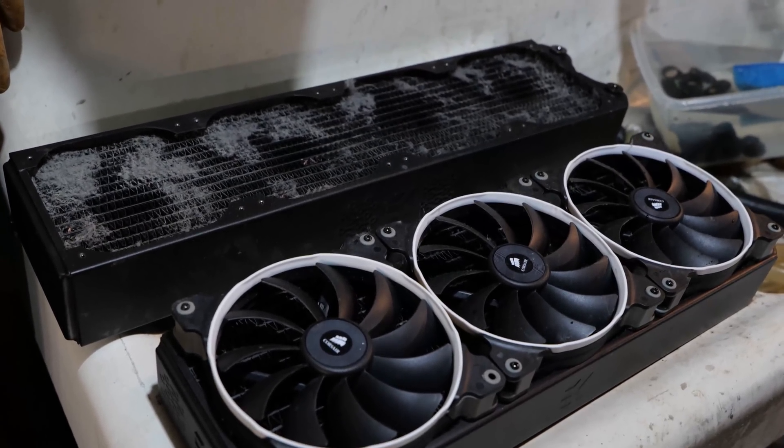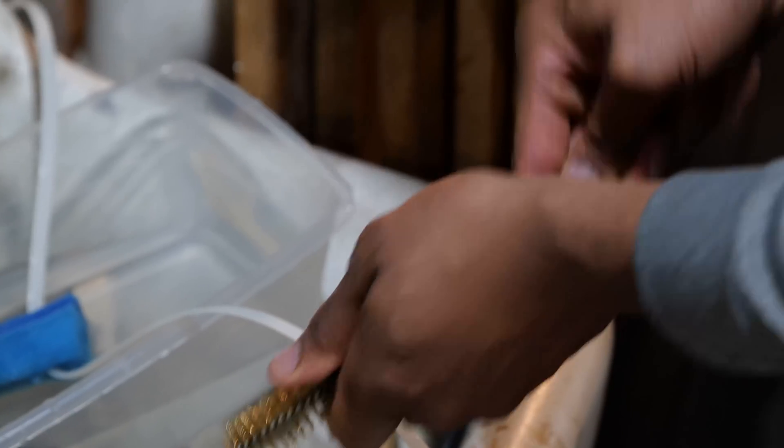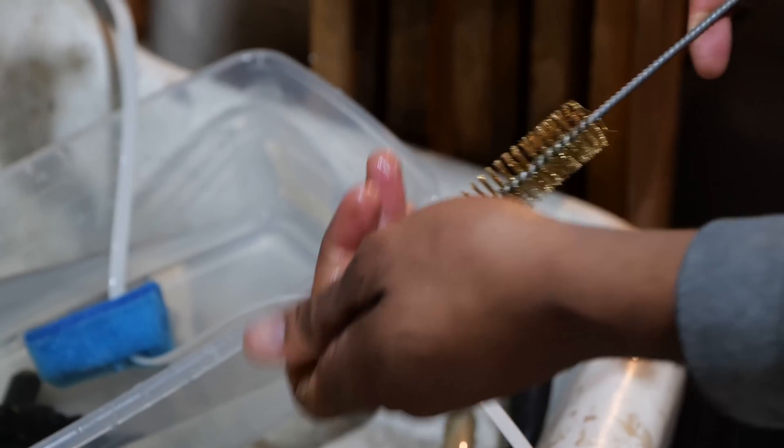He's bringing in a machine last upgraded about five years ago, with some parts even older — like X79. It's a full tower Corsair monster case with a dual radiator. It's got four GTX 980s. They were using these for rendering and basically gave him one because it died. The reason it died, we found out, is because the radiator was junk. We're trying to resuscitate this thing — it's almost like somebody neglected the crap out of it.